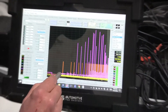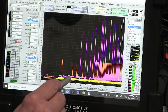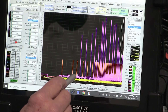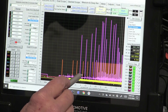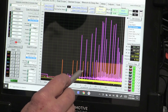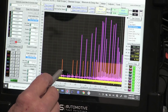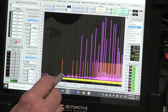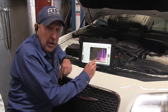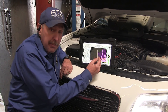Okay, let's go ahead and take a look at this data — the car has started. Right here is where we started to crank the engine over. We can see the crank starts to rotate and I had an injector fire. I come across and I had another injector fire, but in between here I did not have any coil fires. Then I fired the injector and there's no coil fire. Now we come across here and I can see a coil firing in between. It's almost like these are too close together for this to fire. Now we can start the car because we have fuel and spark, but over here we have something wrong. We would not deliver fuel multiple times without a spark — so this tells me I have some kind of problem with the cam and crank inputs. The cam and crank are the inputs that make these outputs which drive the injectors and the coils. These injectors and coils are only on number 1 cylinder, but the same thing is happening on all the other cylinders as well.